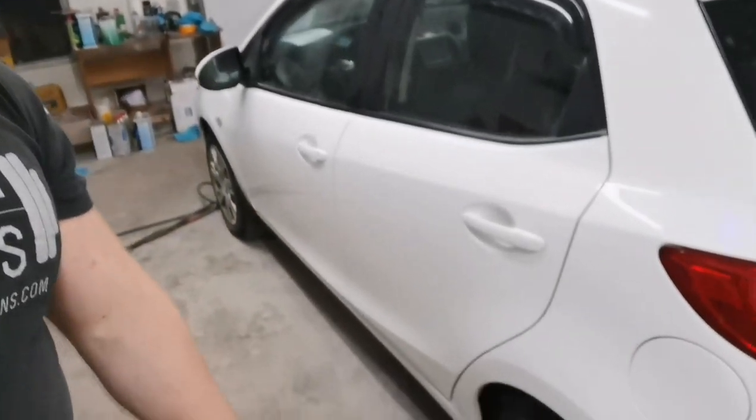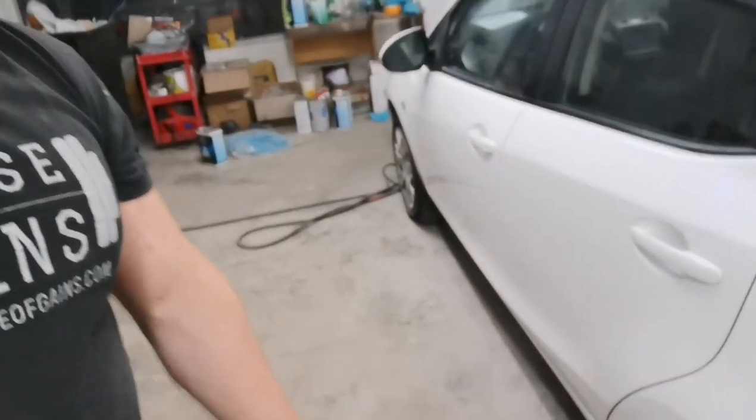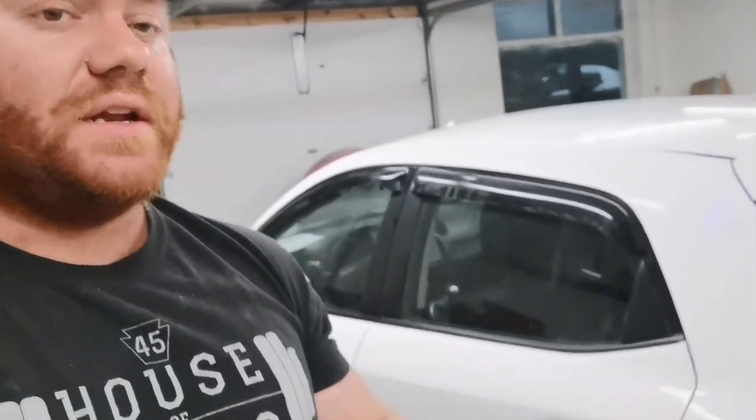The lower solids clear lays out very easily. There's no reduction required. You mix it 3-to-1, you put it in the gun. Sprays very easy. For 48 bucks a kit, I mean, this is white, so it's hard to see the gloss in it. But for 48 bucks a kit, it's got a really, really good gloss to it for the money.